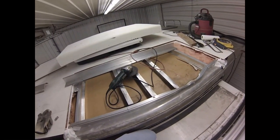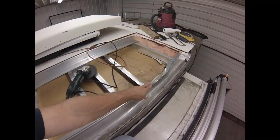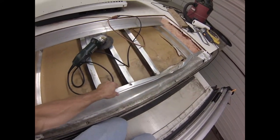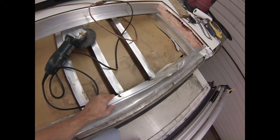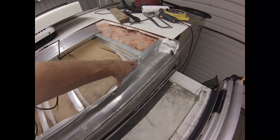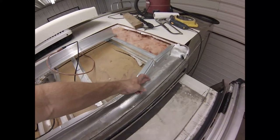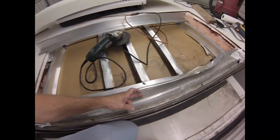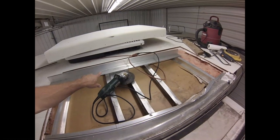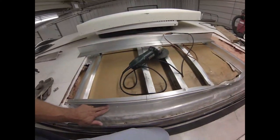Okay, so today I'm going to try to cut out some of this aluminum extrusion, this rail that's screwed down into the wall. That's what hangs these rafters, and it's pretty well twisted up. So I cut through the web here, and I try to cut through here, leaving a lip, and got a piece of angle aluminum I'm going to sister up onto this area here, and back in here somewhere.